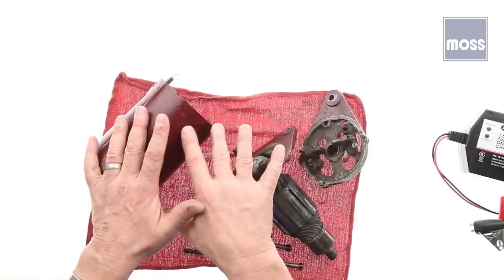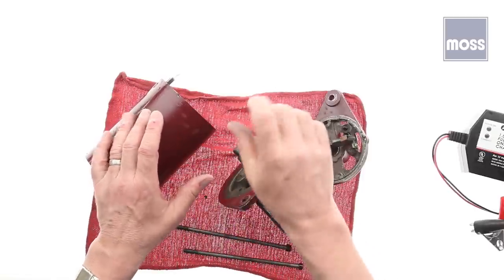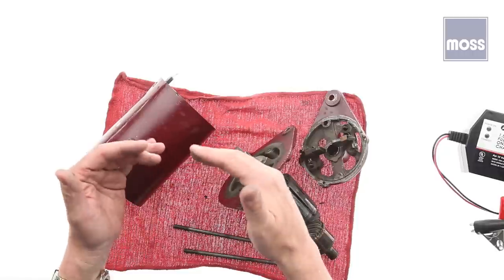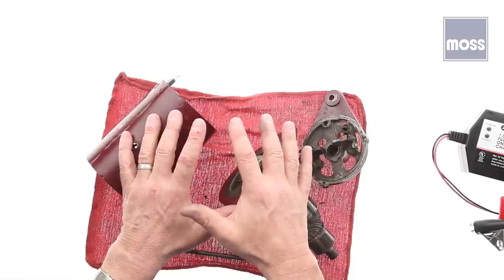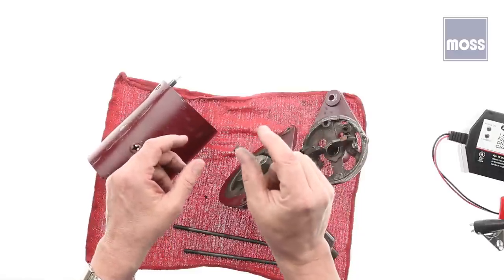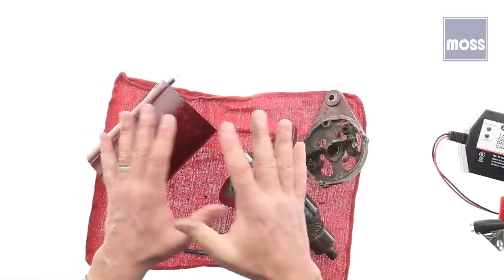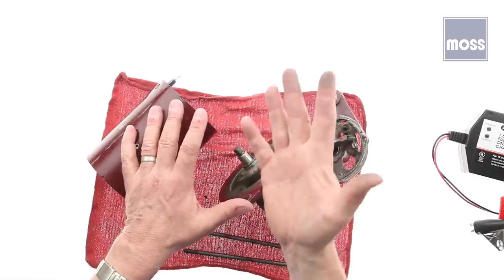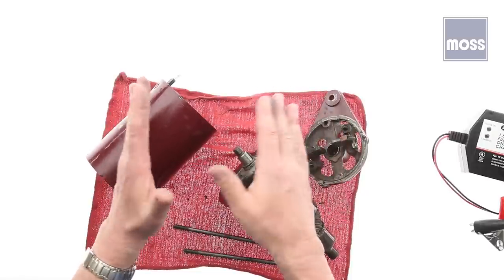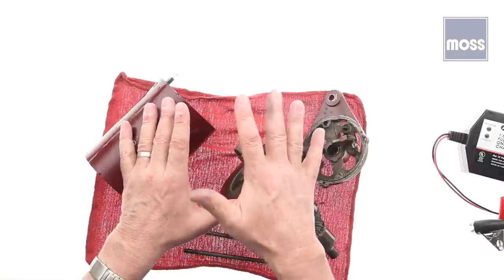Beyond what the charging system goes through, the battery doesn't like to be hit with a high-amperage charge — it can only tolerate it for a short time, like a brief burst after starting. Heavy charges harm batteries. Recharging a depleted battery with a car's charging system is hitting the battery with high amperage. That's why battery chargers are deliberately engineered to bring a seriously discharged battery back up slowly — to protect the battery. High-amperage output options on chargers are for times when simply getting the car running again is more important than the health of the battery.